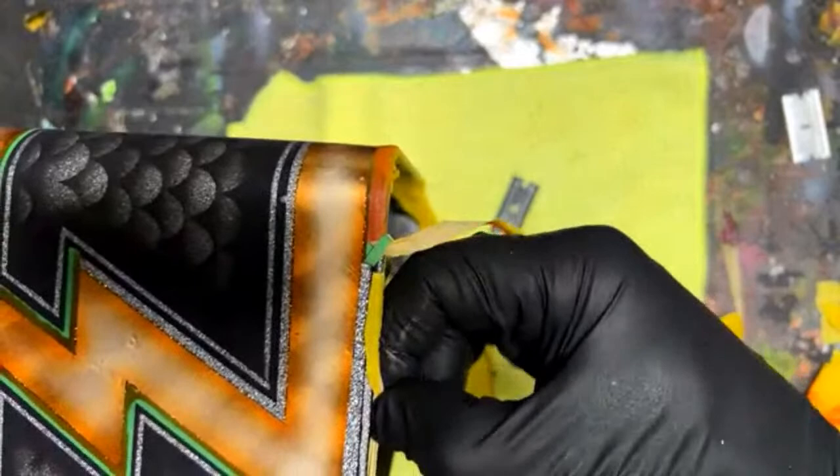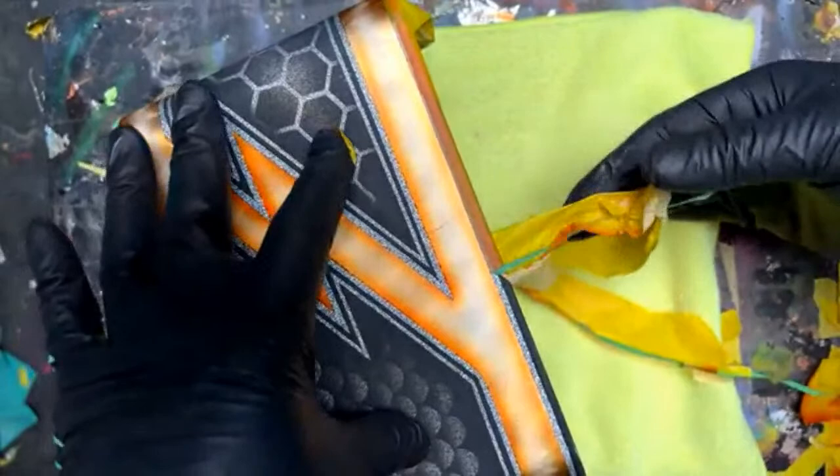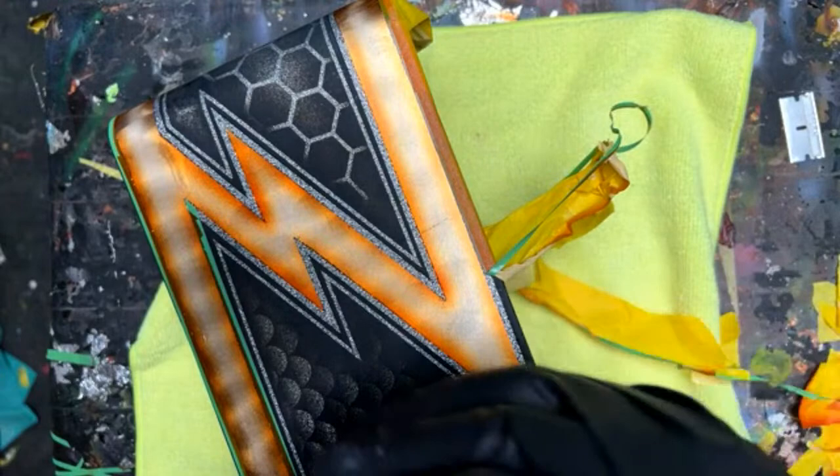You can use inner coat clear. Well, it depends on the question. Actually, you need to use clear coat in order to build up enough of a barrier to sand it. Inner coat clear, you can use to lay the flake, but if you mix the flake in an inner coat clear and spray it, you're going to get more of the texture.